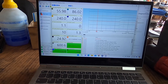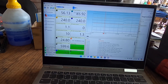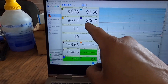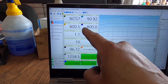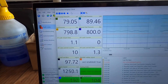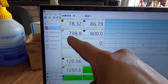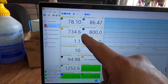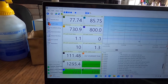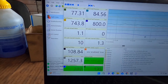So fast-forwarding through the test, it's basically showing you what was going on. You can see this is what's desired and this is the actual rail pressure — it started to fluctuate. You're looking at it thinking it's not too bad, but look at the variance: it jumps from 800 down to 700, drops to 730, then bounces back to 777, 800. That fluctuation — that's a huge variance, and that tells me we have a problem.